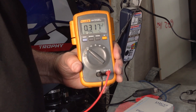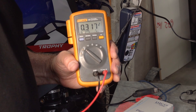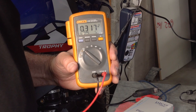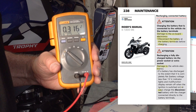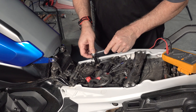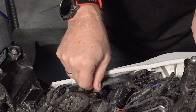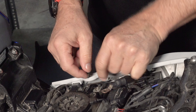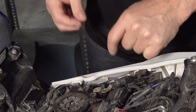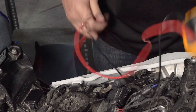As you can see on the meter, we are measuring the battery voltage and it's 0.3 volts — way too low for the charger to activate. So the next thing we have to do is disconnect the battery, as recommended in the BMW handbook. At minimum we need to disconnect the negative battery cable, and that will be the first one you disconnect when you remove the battery. We remove that cable so that the battery has a chance to recover.